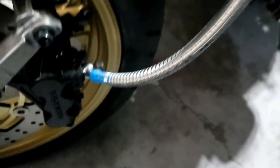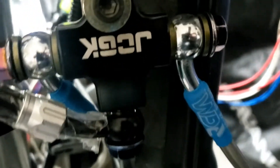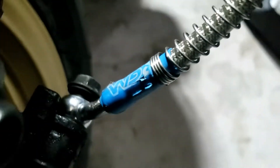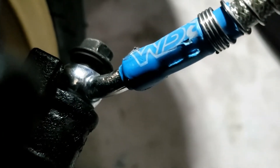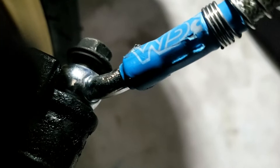That makes a big difference to the way the cable lies. On this one I've got it coming out because I want it that way, whereas on this one I actually angled it in towards the fitting, which produced that lovely kind of curve. And then same down here — it's not straight, it's angled in towards the caliper. Whereas on this side I angled it out, and that was a bit of a struggle to get on. I had to use some long-nose vice grips to hold it while I lined up the bolt. So I'm going to have to take it off and try again.